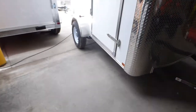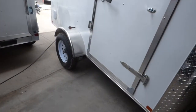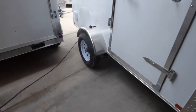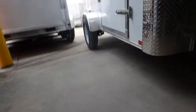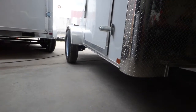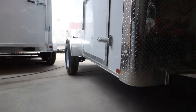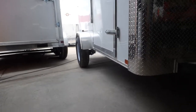We just say that because of the ground clearance. Most of our trailers have a 4-inch drop axle, so with the straight axle on these, they give you some pretty good ground clearance. And then you can do a flip kit on them and gain about another 4 inches, and fit 30s or 31s as it sits. Really good approach angles.